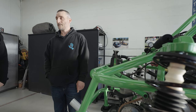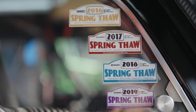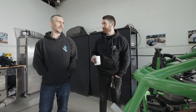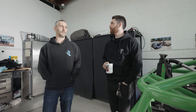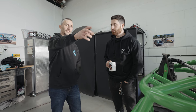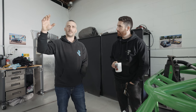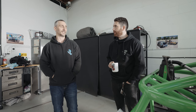This is not a show car — it's been in events, track days, and driven thousands of kilometers, so any bugs have been worked out. The engine-mounted water pump was removed to eliminate parasitic drag; since the radiator is in the front, there's a lot of volume to push. A Meziere electric water pump was fitted instead, providing plenty of flow for the cooling system.